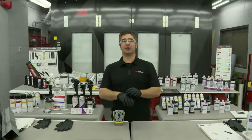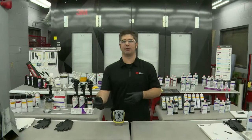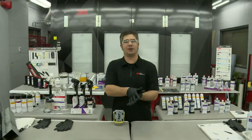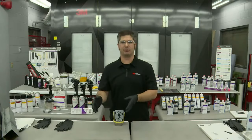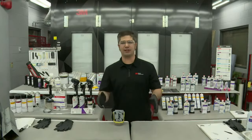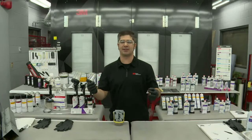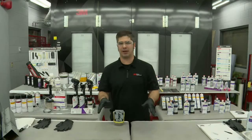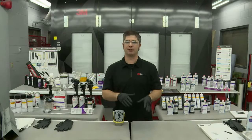Yeah, so like I said, Honda actually came out with the bulletin. Toyota has it. FCA mentions it in their repair refinish guidelines. And what we're really trying to do is replicate, because we can't duplicate, that e-coat process that was originally done from the factory. Because from the factory, all the vehicles are completely assembled. All the metal and aluminum steel components are bonded, fastened, bolted on. And then it goes through an e-coat bath before any seam sealers are applied. And this is where they're getting the optimal corrosion protection from.